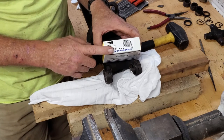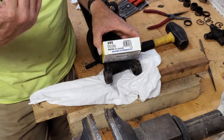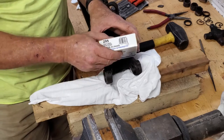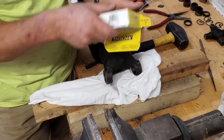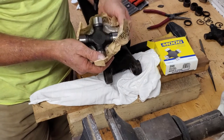I'll put a link for these down in the description, and I'll also put the Spicer number down in the description as well. Both will be greasable. I like the greasable. It gives me an option. You get contaminants in it, you can grease it and push the contaminants out.